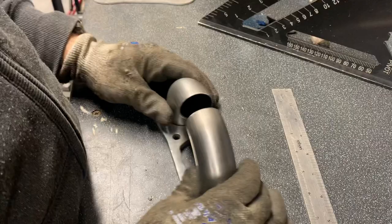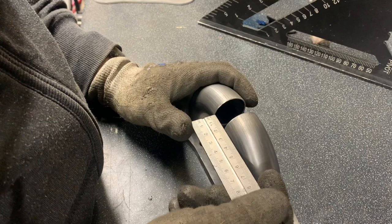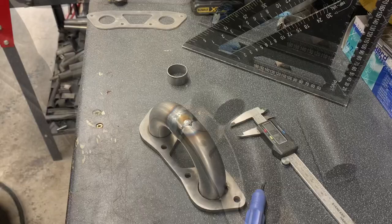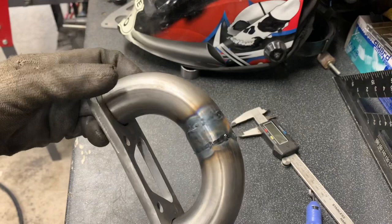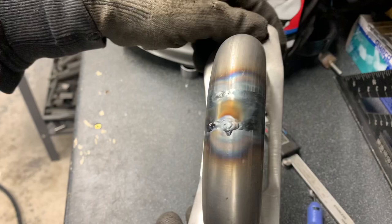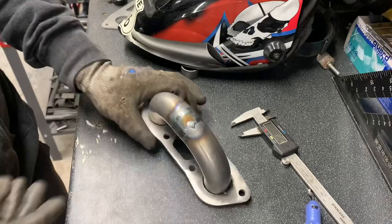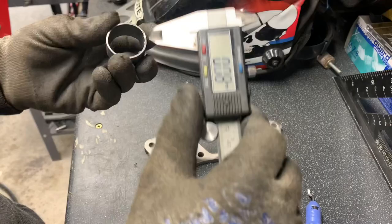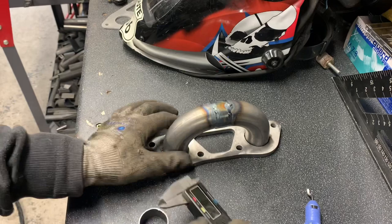So, right, we need to fill this gap. And my gap is 19 millimeters. So, I need 19 millimeters of material. Just so happens, we have plenty. Back up. Right. What I've done there, filled the gap. It's still smoking. Give it a quick tea ground here. Yeah, I might have found a thin spot. That was 75 amps. And this is 1.5 wall. That's pretty bad, right? Right, so that's that bit done.